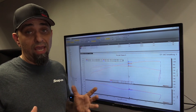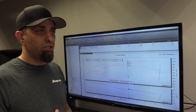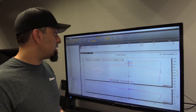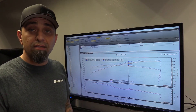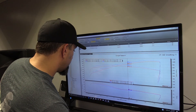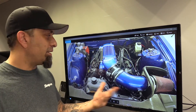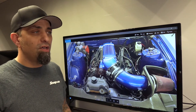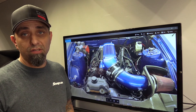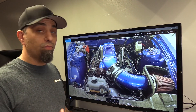This is a great mod. Now I'm sure we're going to get a lot of questions on this, so I'll address it right now. Can I run this on my 132 millimeter throttle body air kit? The answer is, I'm sure you can run it. Will it be a gain? I don't know — we'll test that out once we have some production units. My guess is it might help a little bit. The other question a lot of people are going to ask is the mass air signal quality. When we first posted this, a lot of people questioned that. I'm not going to post any data logs right now, but I will tell you that I was surprised at how clean this mass air signal was. All in all, a success on all accounts and we'll keep you guys updated. Thank you.